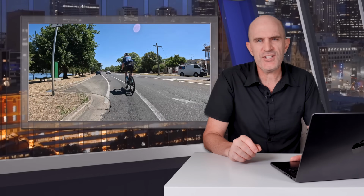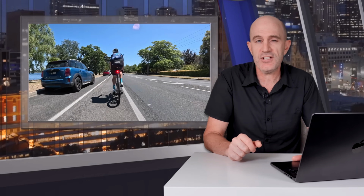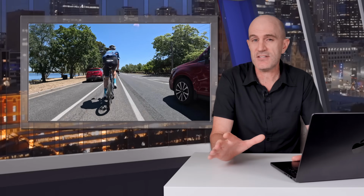Takeaway number 5 is a quick one, and that is the change in geometry or bike fit. My gravel bikes are set up a little shorter than my road bikes for overall reach, and I felt a little cramped on the setup of the Aspero when it was in road configuration. Now I found a middle ground by installing a longer stem, so I'm now running a 120mm stem on the front of the Aspero. And finally on to takeaway number 6, and it's a plot twist.